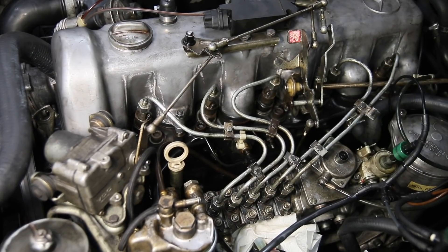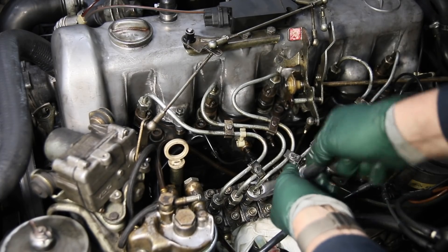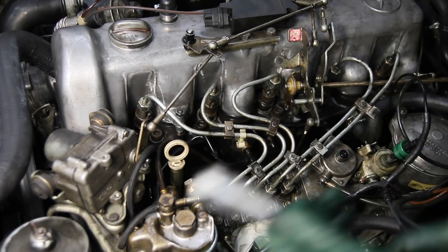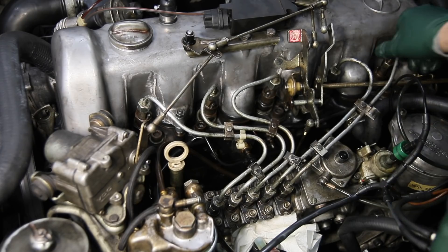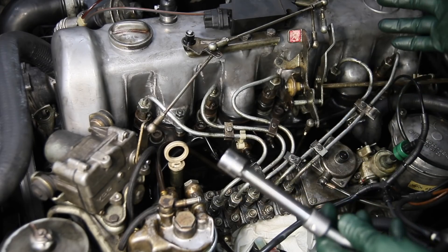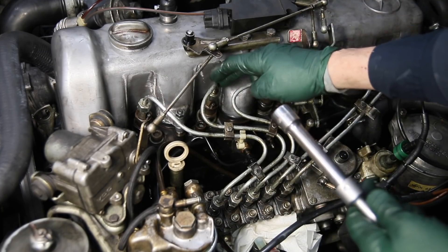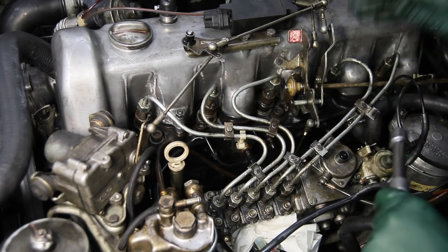They're all started by hand — now I'm going to use the wrench and get all these turned down. I'll tighten these down tight, then I'll run these in until they're kind of snug and then back them up a half a turn. I want to leave these loose at the top until I do the bleed procedure. You're going to have to turn the engine over — I'm not going to cover it in this video because I have lots of videos about bleeding the system — but you'll use a primer pump, pump up the system, turn the engine over with the starter until you see fuel coming out of each of these injector lines at the injector. Then tighten those down and you're ready to go.